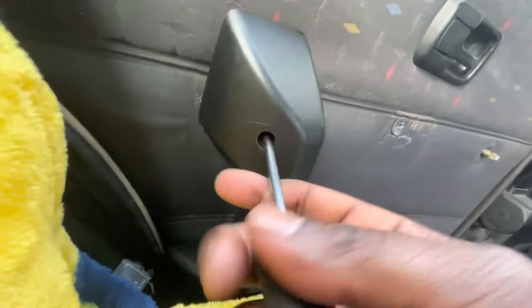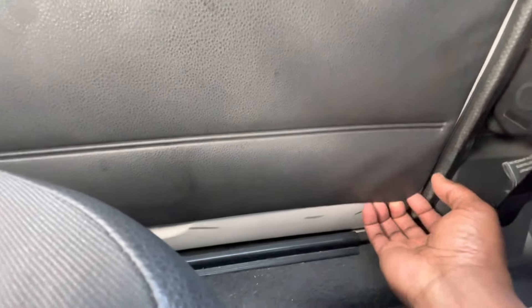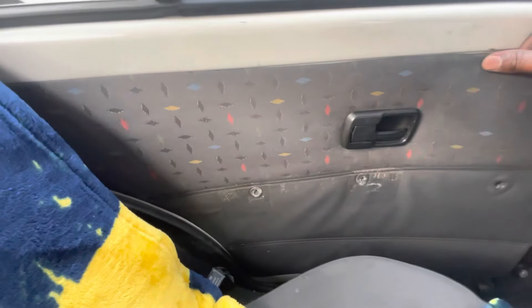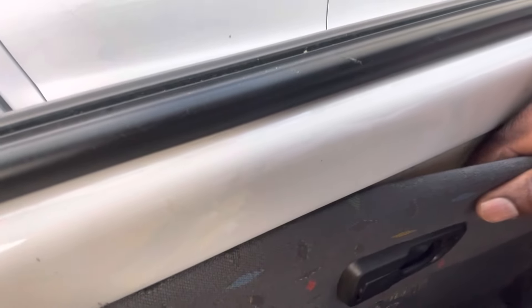I was hoping my wife would do this one, but I decided to surprise her and help create some content for her channel. Opening this door panel is a bit difficult. I realized that opening from one side is easier — it seems to be the weakest point. To make matters worse, this door is still original; it's never been opened before. The top right clip is a bit tricky because there's chipboard under the cover, so if you handle it wrong, the clip pulls from the cloth part of the door panel rather than the white board. You need to be very careful there.